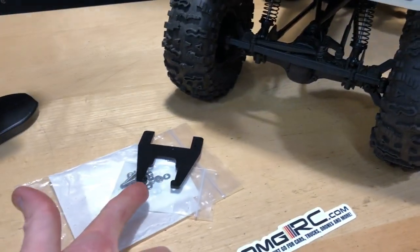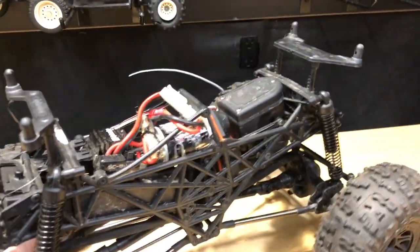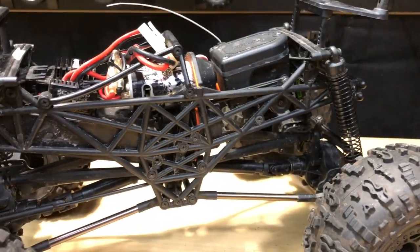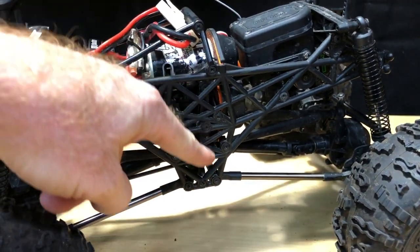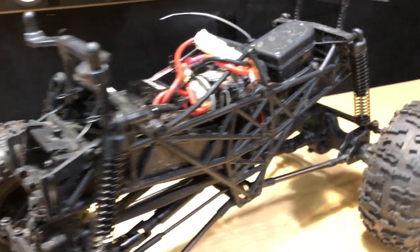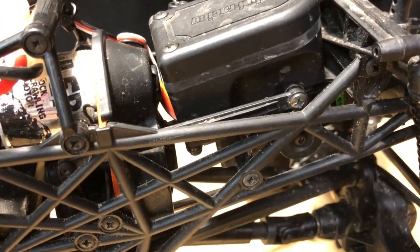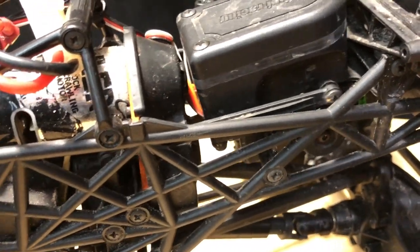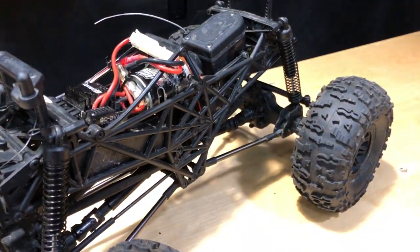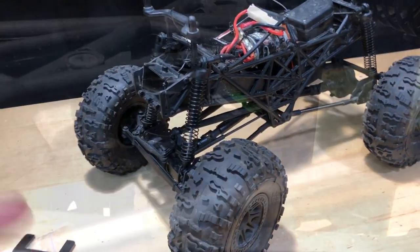We got a relocator kit right there. Let me show you how this thing is set up — maybe you have one of these or you're looking at one. The servo is all the way in the back. If I turn the wheel you can start to see the little mechanism come down here, so if you focus in this area you'll see it all moving. The issue is the little servo saver in there — it's just not all moving, so we'll take a look at the servo and go ahead and get this thing relocated to the front.